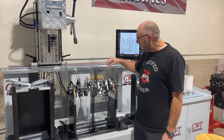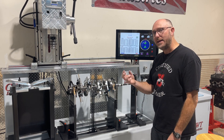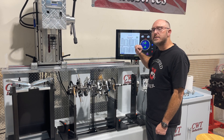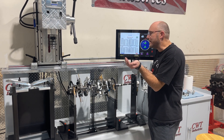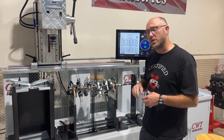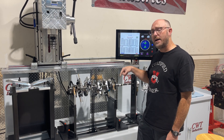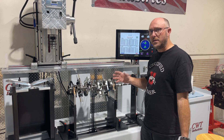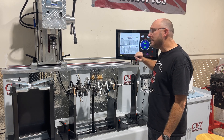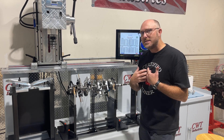Here's where it gets interesting. As that weight spins, the centripetal force multiplies by the square of the RPM. So that little tiny piece of clay I added — here's what it did for me. At 10,000 RPM, which is going to be below what I intend to run this engine to, that 6.675 grams — that little tiny bit of weight that's out of balance — is causing a force of 115 pounds to be applied to the crankshaft at 166 times per second. So the frequency is like taking a jackhammer with a 115-pound end on it and going bang, bang, bang at the exact same spot every time the crank goes around, 167 times a second. Now those are pretty small numbers in the grand scheme of things, but that little tiny piece of clay — reducing me about five and a half to six grams — now at the same RPM, I've only got 18.6 pounds of force at that same frequency. So we went from 115 down to 18.5 pounds.